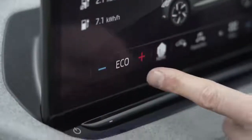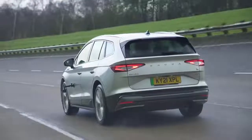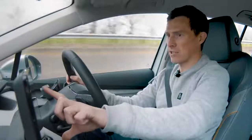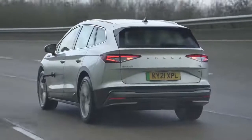I'm not going to run the radio. I'm also going to put the windscreen wipers on. Resetting the trip now. Coming up for 10 miles - 1.9 miles per kilowatt hour with everything running. Multiply that by 77 kilowatt hours usable battery: 146 miles of range at 70 miles an hour with everything on. That's reduced the range by 54 miles just by having all the systems on - that is insane.